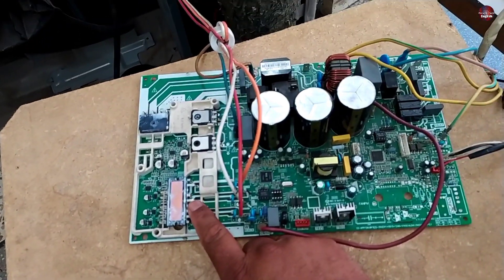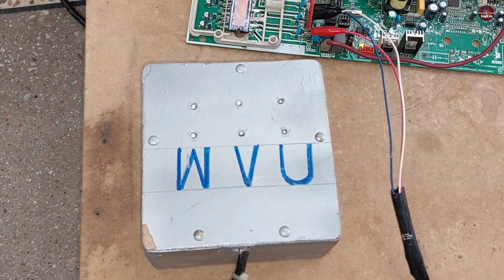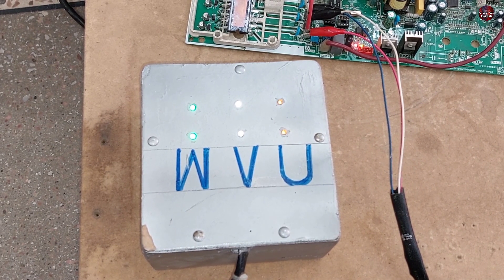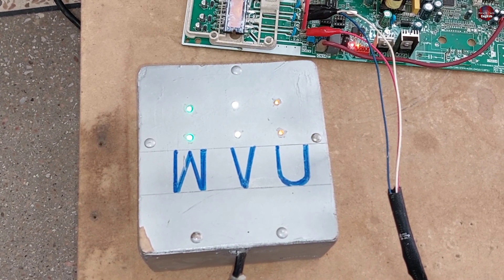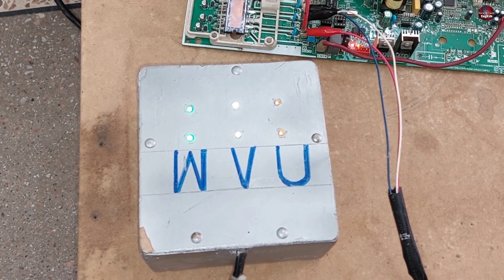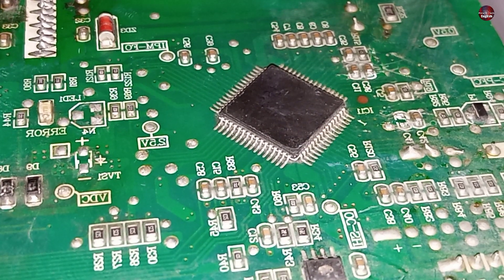Now let me explain why this PCB could not be repaired. When I attached the analyzer, all the IGBTs turned on but the lights on the UVW were glowing, not blinking. This means a pulse was not being generated. All the phases of the IGBT were turning on simultaneously and then turning off, which made the strange noise inside the compressor. This was the main reason — the IPM control microcontroller had gone faulty.